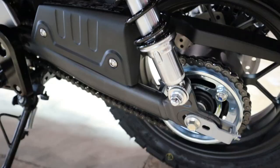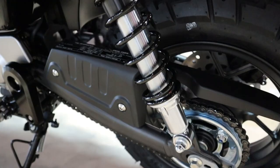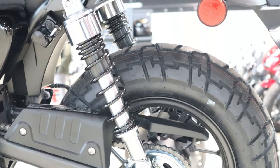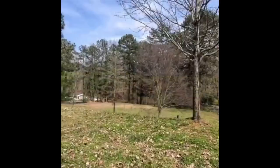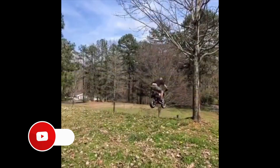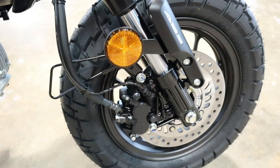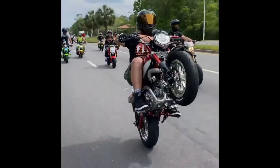On the rear suspension, we see some new changes. The dual rear shocks now feature two-stage springs and revised damper rubbers to help improve ride quality on bumpy roads and reduce bottoming out, which was a common complaint among larger riders. One of the best areas to spend money on if you like to modify things is the suspension — bringing in some adjustability lets you fine-tune it for your weight and riding style, whether that's mobbing the streets or heading out for a leisurely cruise.